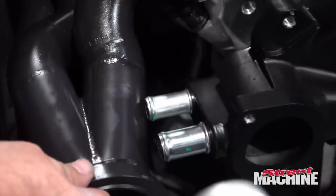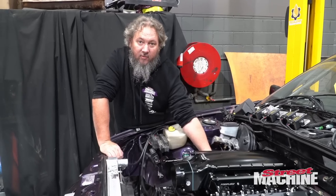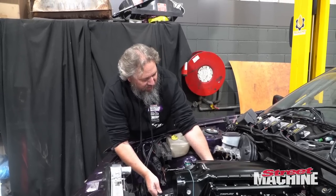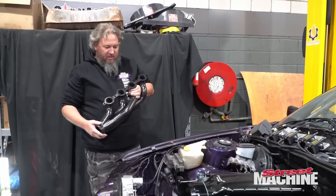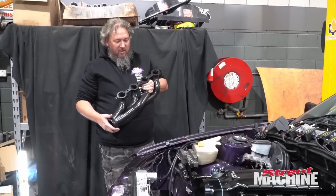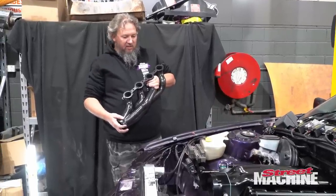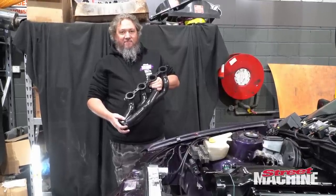That's going to be a problem. Right, well, when the boys made the pipes, we had the electric water pump on there, which didn't have those fittings. So what we're going to have to do is pull out those pipes and get someone to weld up the fittings. And if we need fittings, we can always drill and tap at a later date, you know, at a 90 degree angle. But yeah, we're gonna have to lose those pipes. It's not something we haven't done before.